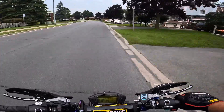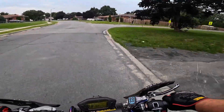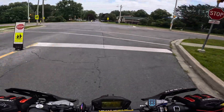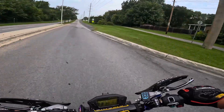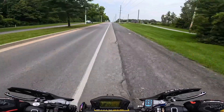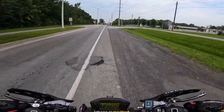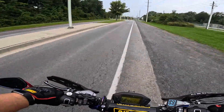I gave the bag a nice cleaning, wiped her down, gave her some lubrication, and added the rest of the strobe blades — so now I have all four strobes on it. I added them to my splash guard. At first I had them zip tied on and they looked really crappy. On one spot I tried a self-tapper and it didn't work out. Then I realized I could just drill the holes a bit bigger to use the stock hardware — one bolt holding it down and a zip tie holding the wire in place. Perfect.